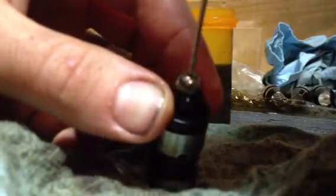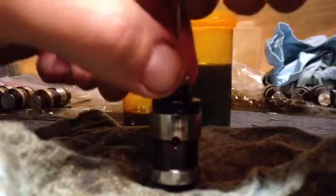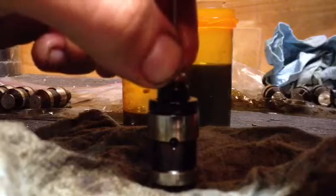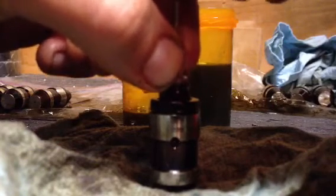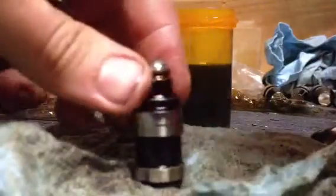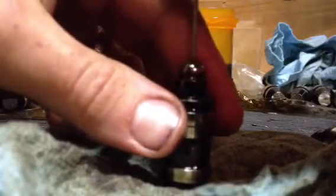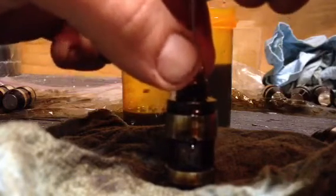What's going to happen is when you push this pin through the top, you'll feel it center itself inside. It gives you the capability to push down on it, and it's going to unlock and come through all the way. Another way to tell if it's getting gummed up — you push down on it and you'll feel on the inside, you can probably even hear it. It seems like a lot of friction; this one seems to be gummed up pretty well. If I push down on one of the ones I just cleaned, centering the pin inside — it's very, very smooth going through.